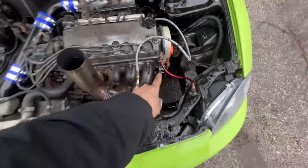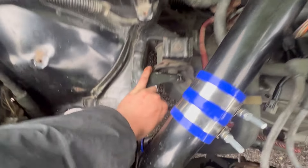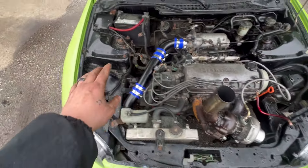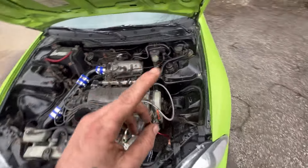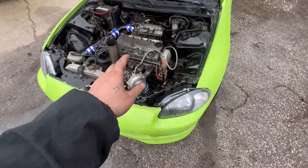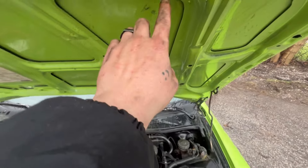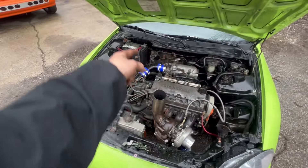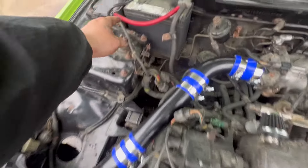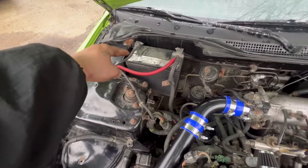So the only grounds he has — this one right here is really corroded and broken. His car wasn't starting — no clicking, nothing at all. I got there and we closed the hood and push-started the car. Right as it started up, it grounded out onto the hood because these grounds don't work. We gotta put new grounds on it — it doesn't have one going to the engine. It needs a ground from the engine to the battery.